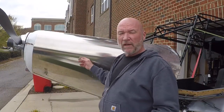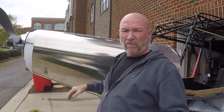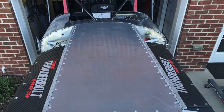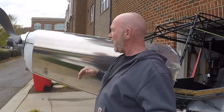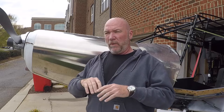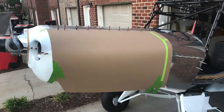Today's Friday, November 22nd, 2019 - cowling is completed. It took a lot of time. I built this cowling from scratch, fitted all the panels, started with poster board and used those as templates. The top cowl is 0.032 aluminum, everything else is 0.025. I started from the nose bowl, got the channels from the nose bowl back to the firewall, then started with the top piece, cut an access door for the oil, then did the bottom piece, and finally the doors.